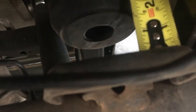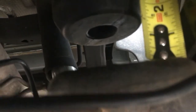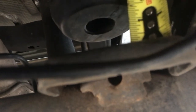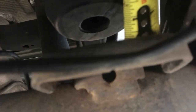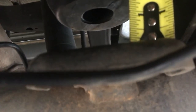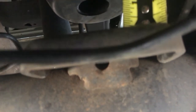I think we're about there. I've got the Timbrens installed and they tell you to have about half an inch to two and a half inches of spacing. You can see we're pretty close to two inches on mine, but this is actually what I want — maybe a little bit less. Because we've got the Roadmasters on here and the truck generally takes quite a bit of weight anyway, I'm going to see how we do with these. I'll hook up to the trailer empty — it's about a 3,600 pound trailer empty — and see what kind of gap we've got.